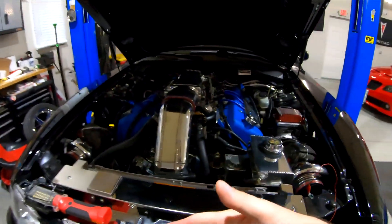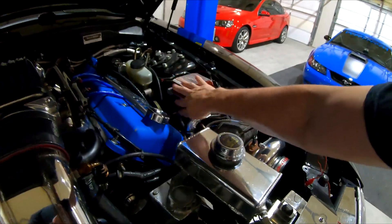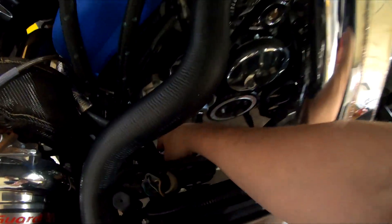I got out and listened and my electric fans weren't working. So I did the basics — I came out here and checked the fuses in the box and the fuse that goes to the fans. I found that if I hooked a wire straight from the battery to the fans they came on and worked fine, but no fuses were blown.